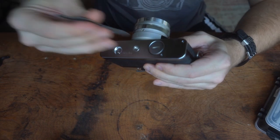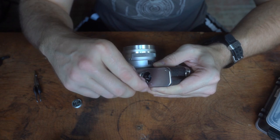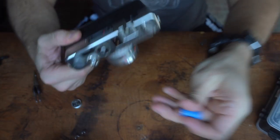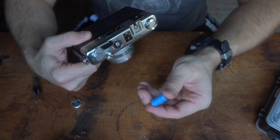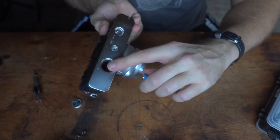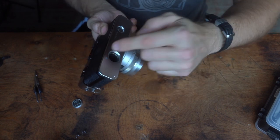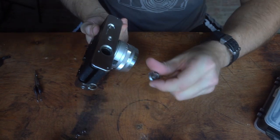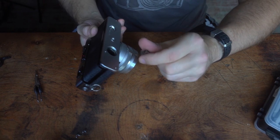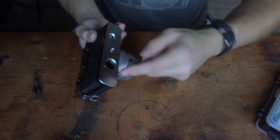We're going to start by removing the batteries — always a good idea when working on an electrical camera. This is my self-made battery adapter: a spring made out of a paper clip and a little stack of 357 silver oxide batteries, stacked four high. I made a sleeve out of a plastic 35mm film canister, drop the batteries in, put the spring on top and it works perfectly. Amazon does offer a dedicated fitted battery for this — I'll put that in the description — I think it's about $13, but these four batteries cost me about $7.